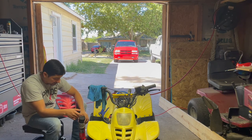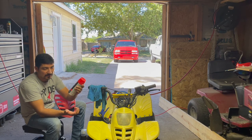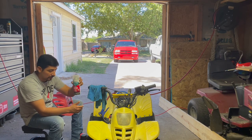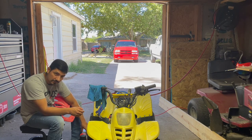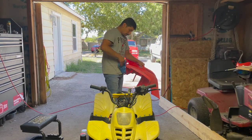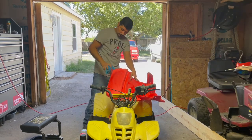I'm going to use rubber undercoating for the bottom half. For the top half I'm going to use regular Krylon all-in-one paint and primer — it says no peel guaranteed, but if it's on plastic it's going to peel. I'm going to do two coats of that, and then for the top coat or anything I paint red I'm going to use a crystal clear gloss to keep the shine. So the steps are: blow it off, wipe it down, adhesion promoter, filler primer, whatever paint or undercoat you want, and then one layer of clear gloss. This is after two coats of adhesion promoter.